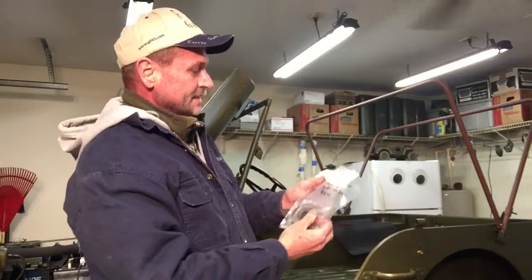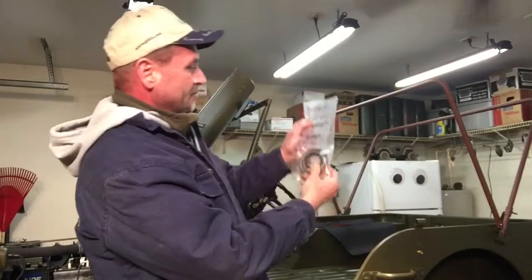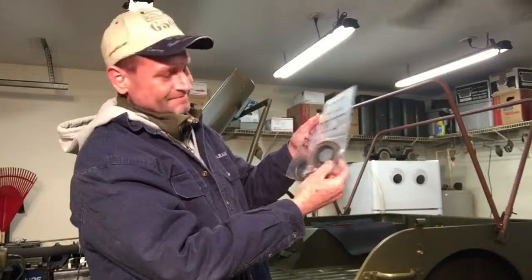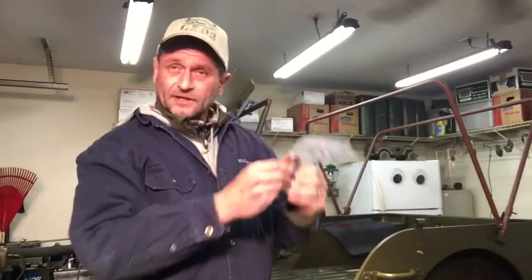And from the ones I see, Dana 18 shift rod seals, that's fantastic. Got the pinion seal, even tells you the spring goes inside. I made that mistake once, won't do it again. And we got a Dana 18 output seal also. Check them out, I'm telling you, I'm looking at this stuff and it's quality. I told you guys before, we're running the face, talking about good Jeep parts, and you got a guy like Ron Fitzpatrick who's going to step up and say, hey, I got those. I've done the research, I've done the work. Check them out, tell them Haines Garage sent you. Or Scott Schiller.